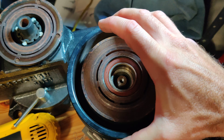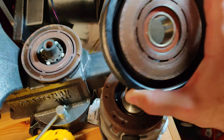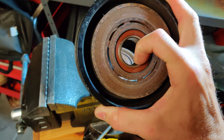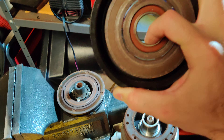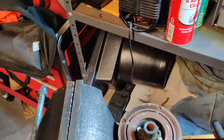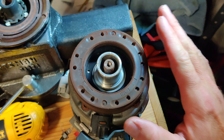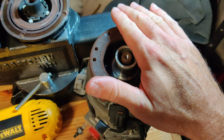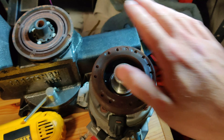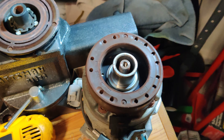The bearing comes off the shaft, and basically the pulley along with the clutch disc and the bearing that makes the pulley run comes off as one assembly. Maybe you're lucky and you just need to replace this bearing — not the case on this car. Now you can see the electromagnet. When you press the AC button, it sends current to this electromagnet, which sucks down the outer clutch disc into the part that's always rotating, the center shaft begins to spin, compresses everything, and you get cold air.